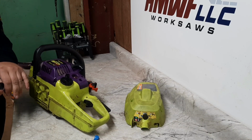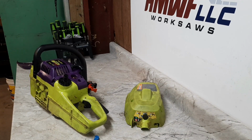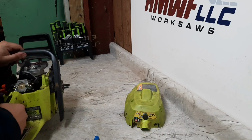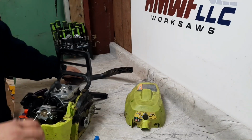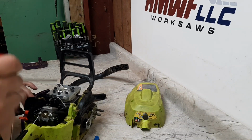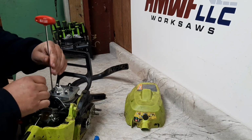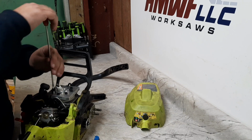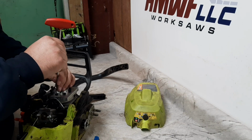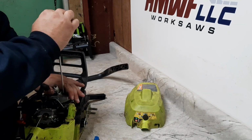But honestly, I'm super happy with this. This is the first time I've ever pushed a build like this, and it was some general knowledge and a little bit of a shot in the dark. And this is what we ended up with, and it's actually ran quite well for a decently long time. I went with 8 head bolts in this nice thick ring because I wanted this head to seal. I've heard of people having sealing issues with the longer studs and only 4 bolts and those kind of things. So I didn't want to have those issues on this one.